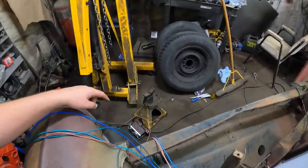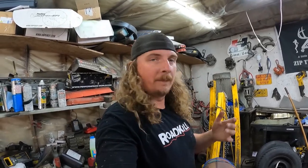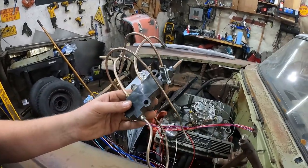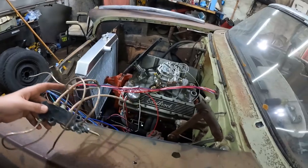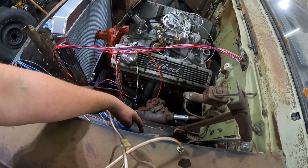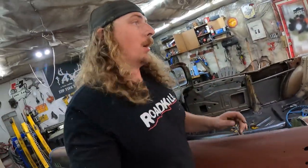I dropped the master cylinder. I always just get a 68 to 72 Nova front disc master. So we're going to use that. This is like your generic metering block, which looks like it's already set good. I'll pull the old master off, slide the other one on. I usually just bolt or weld a couple of tabs to the inner fender. I also found a hood bar in the basement while looking for parts — it's a little pitted but it'll suit this hot rod.